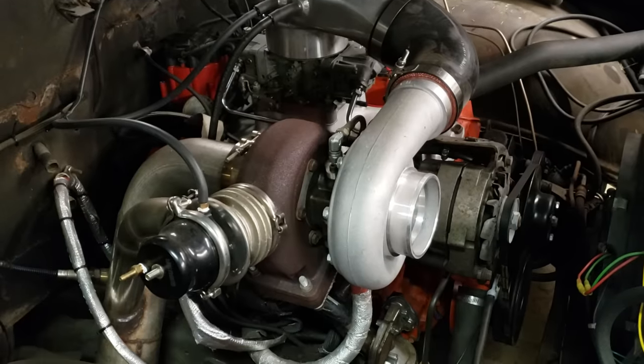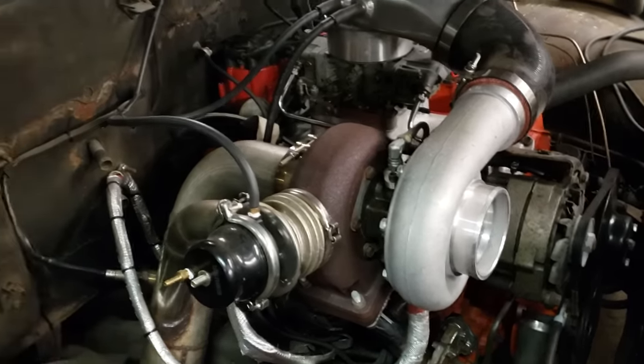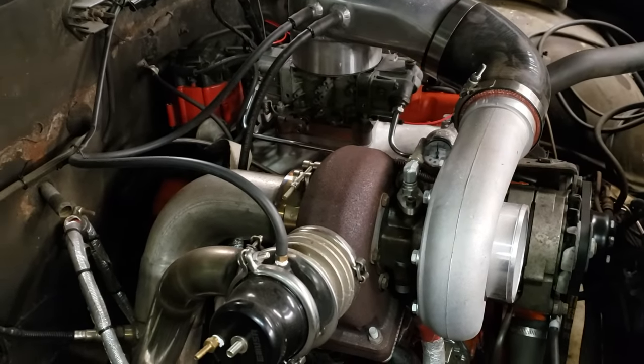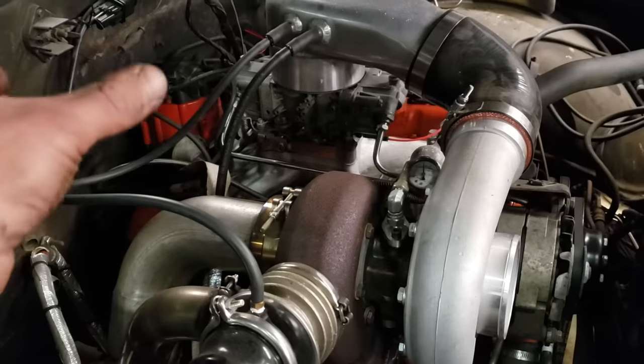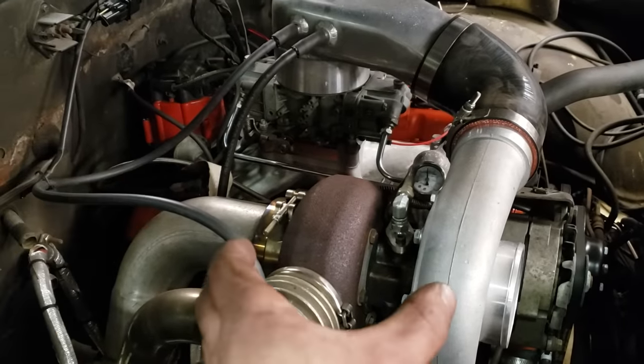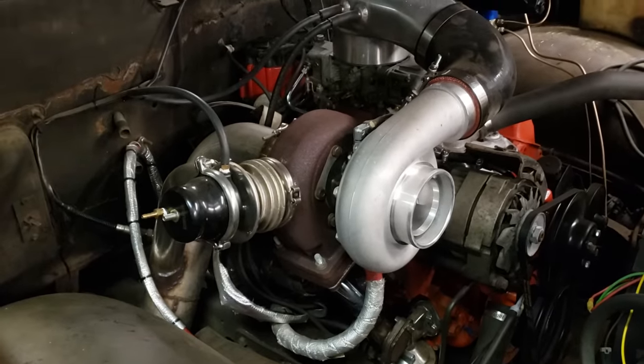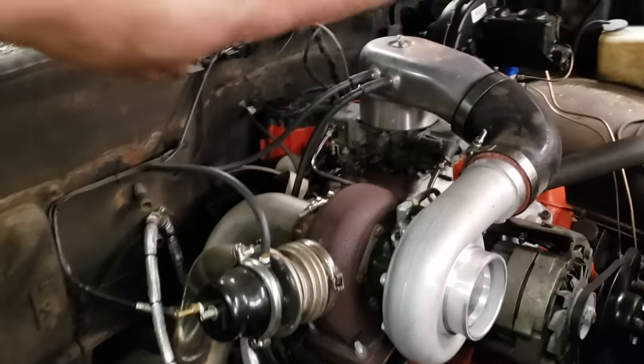It's not off by half an inch — it's like three inches off. I believe the manifold dump is back here and that pipe came up over here. So I had to remake the piece that joined them, fabricating an S-bend to connect them.